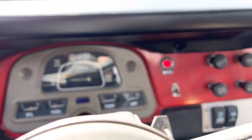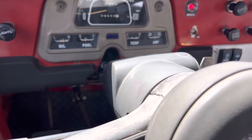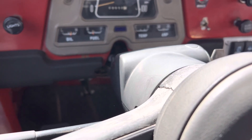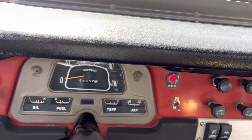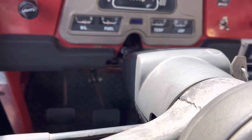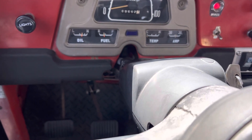The reason for the two sets of gauges is the factory gauges are electric and the aftermarket ones are all mechanical, so they're kind of like a redundant backup system. The oil temperature gauge — I've had it up a few degrees, maybe up to about 160°F when I'm out running hills where I'm working the engine hard. Other than that, you really don't see much movement on that gauge.